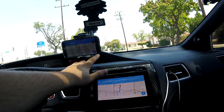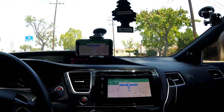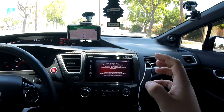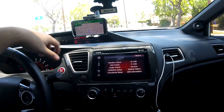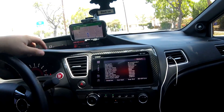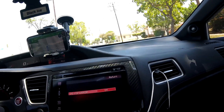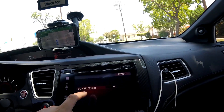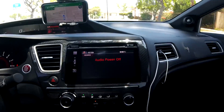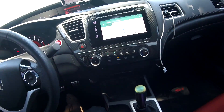What people are going to ask is: what about driving around — won't the e-brake stop me? To fix that, hold the power button, the home button, and the eject button at the same time. It's going to come up with a menu — click 'Detailed Information and Setting,' then hold the menu button for a couple of seconds. Click 'Vehicle Model Information' and click the 'DD VSP Error' option to turn it off. It's originally going to be on — that's what keeps you from driving with the e-brake down. Click it off, return, then go back to HDMI. Note: this setting does not stick, so you'll have to do it every single time.